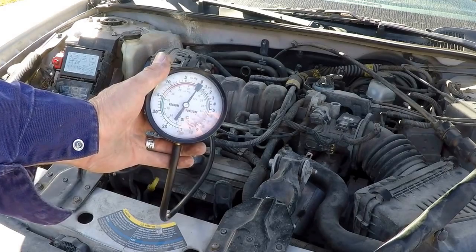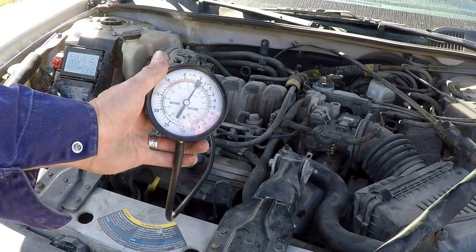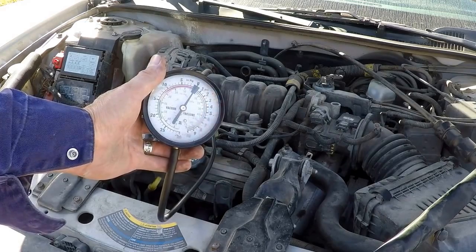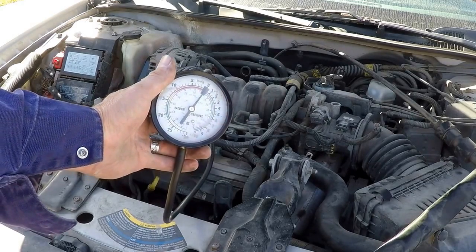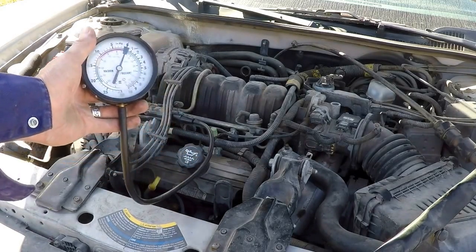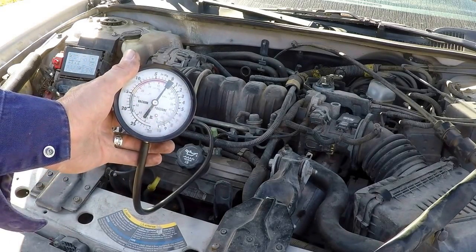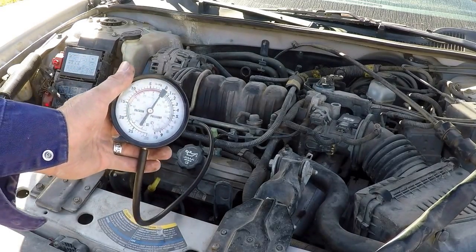This one's not leaking, which is great. These purge valves operate normally closed, so right now it's in closed mode and we're not leaking by — the valve appears to be good. As we saw, the disconnected hose is reason enough to pop the P0455 code, so that's what we found.